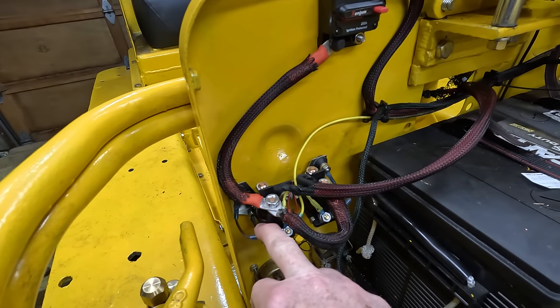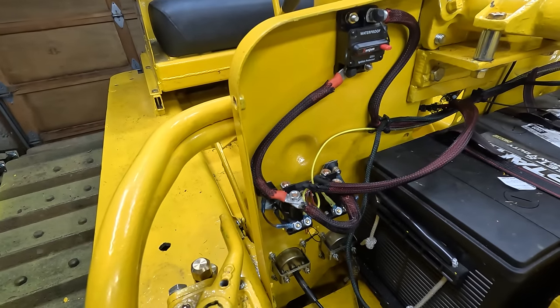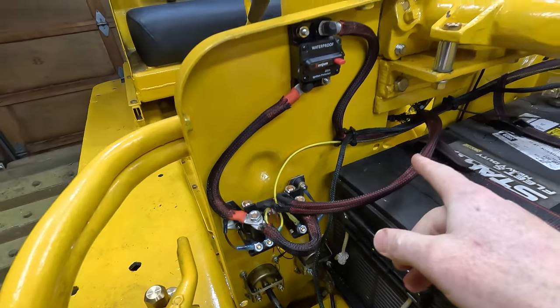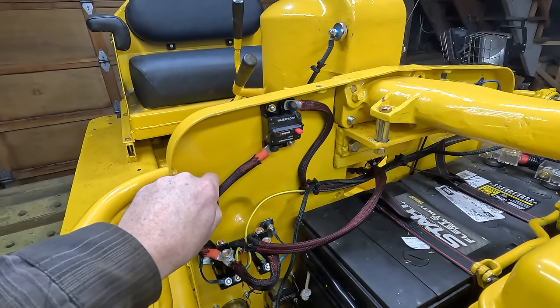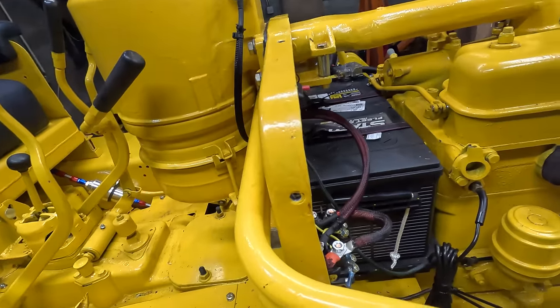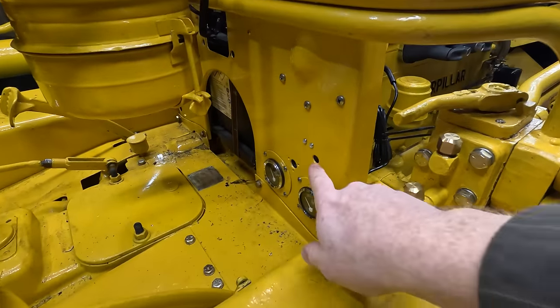This is a Cummins heater relay. This is how it's set up there. And I think these gauges of wires are actually bigger than they are on the Cummins or the Chevy. They're way smaller than what the current load is, but since it's only running for a few seconds, it doesn't really matter. So when those relays close, then these lights turn on.